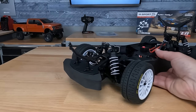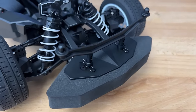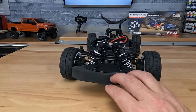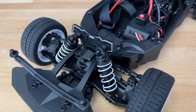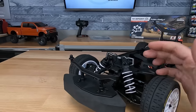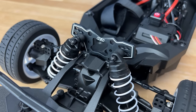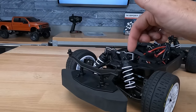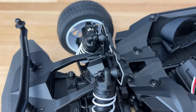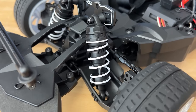I'm going to try it on asphalt and dirt to see how it goes. Starting off with the front: there's a large front bumper spanning out from the chassis plate, supported on top and bottom with a foam bumper pad that will help support the front of the body. The body mounts are in the front, which is nice so that front end won't flop around. Getting into the suspension — it has aluminum shock towers with a really nice design, a bit of etching around the outside with the CEN logo. Looks like it's a two millimeter thick plate with plenty of shock mounting points so you can tune the suspension. The 12 millimeter shocks are composite body and threaded so you can adjust preload — it feels really good, a nice plush suspension setup.